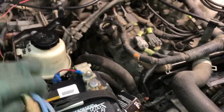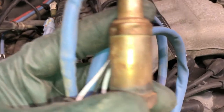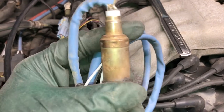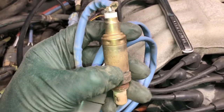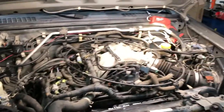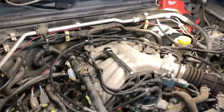I want to show you something — this is the original O2 sensor. As you can see here, it says Bosch on it. And there's a Nissan emblem right there. So that explains why I've had really good luck on these Nissans using Bosch O2 sensors — it's because they make the factory part. So save some money and just buy them from the aftermarket. Just get a good quality Bosch O2 sensor. There's no need to go to the Nissan dealer unless they give you a good discount.